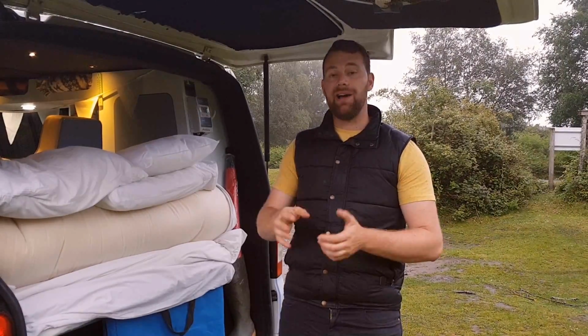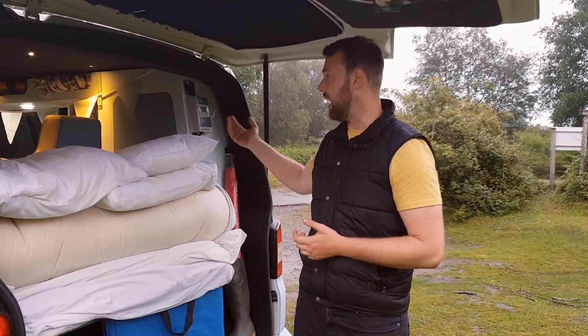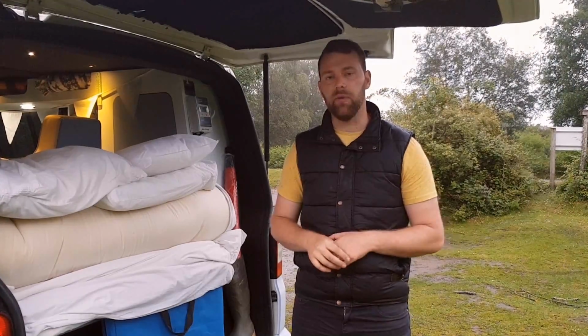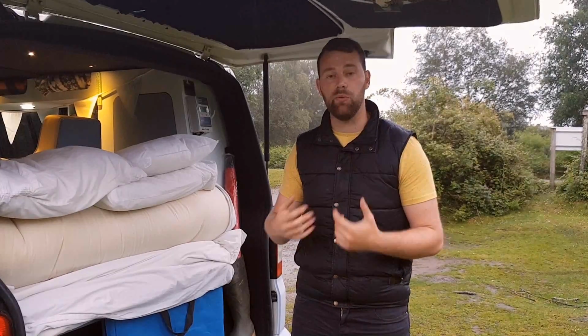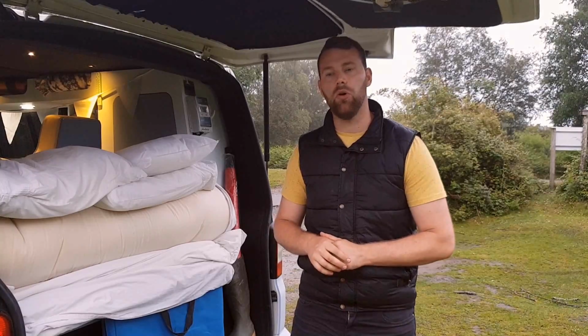Lithium ion batteries or lipo batteries, you can get about 800 to 900 cycles, so that's why they generally last a lot longer. I would expect a system like we have to be fully charged and maintained with the panel and the split charge to last somewhere around about 5 years to 6 years, and a lithium ion system could last potentially up to about 8 years, so they will last a bit longer, those lithium ion batteries, and you can abuse them a bit more.